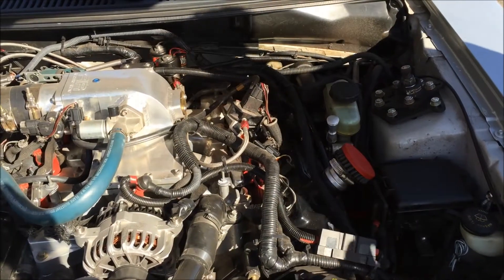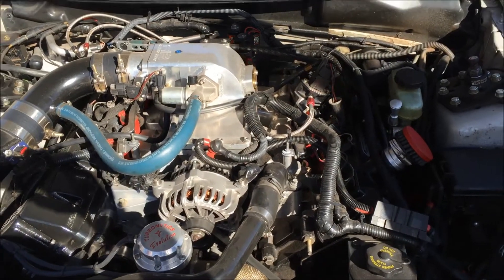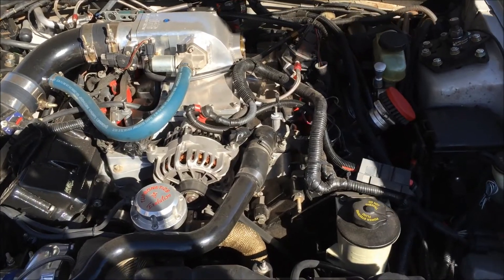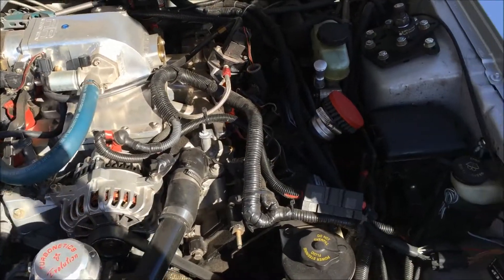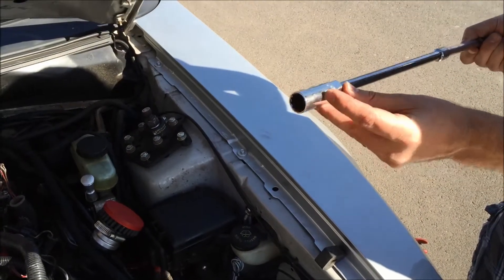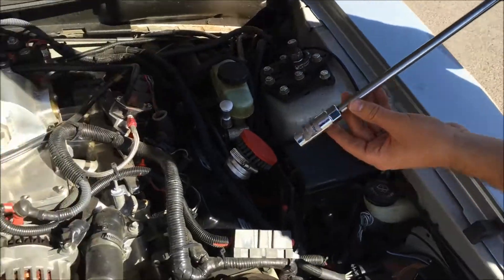You want to make sure that the car is not burning hot — like it hasn't been run hard. You want to let it cool down for a minute. You can do this on a cold engine as well, just make sure the car isn't really hot. Then you're going to take a 5/8 inch spark plug wrench — it's basically like a typical socket except it has a piece of rubber in the front that helps hold the spark plug once you get it out.